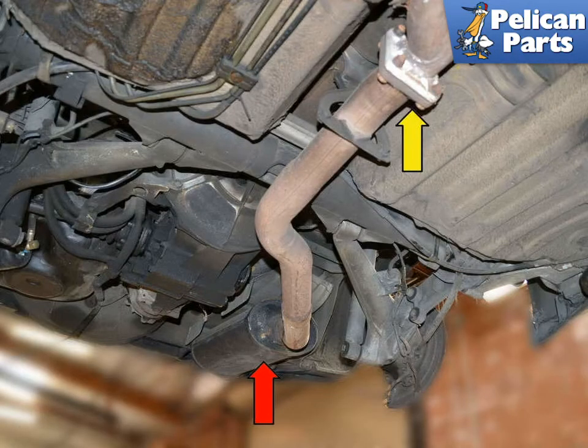While you can remove the transaxle without pulling the muffler, I find it easier to remove the muffler as it gives you more room to work. If you would like to remove the muffler, there are 6 bolts in total — 4 of them at the catalytic pipe joint and 2 at the hangers. Or you can follow the link provided at the end of this video for additional assistance with that task.